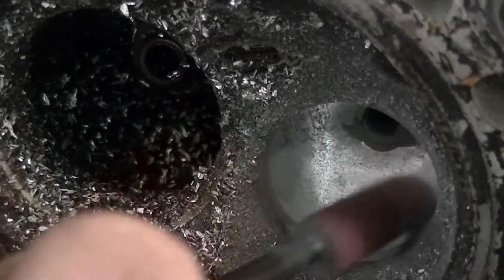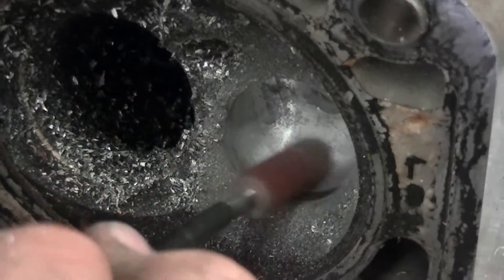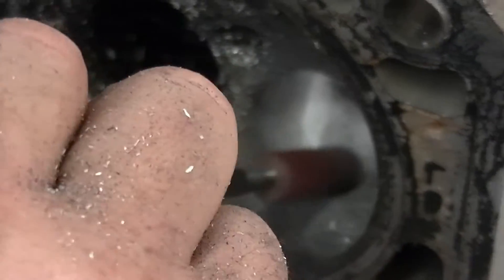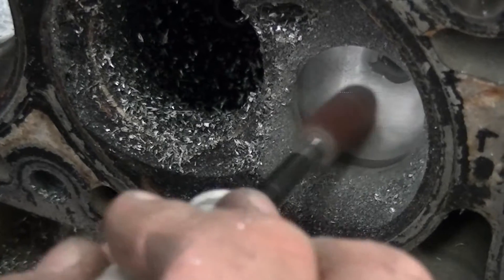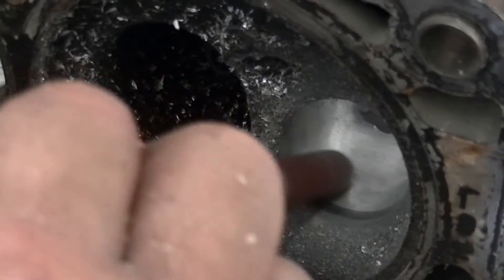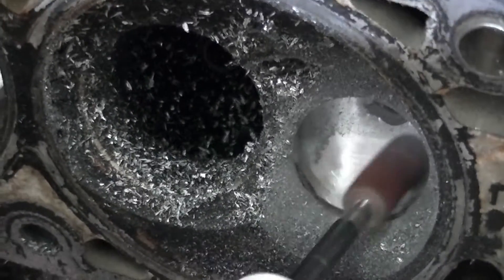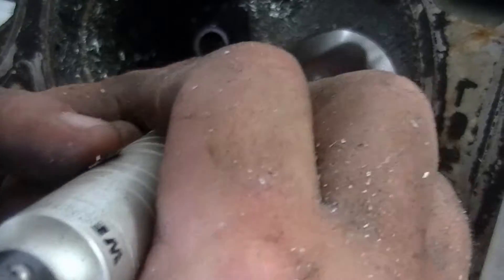Just keep erasing it — this is probably the hardest part to polish up, because of the way it sits and it's real hard to get to. And honestly, because of how much you have to take off in the porting process — you guys saw how much we had to take off. Now we take this and we're going to hit that guide one more time, just to polish her up real pretty.